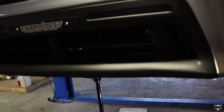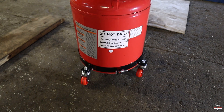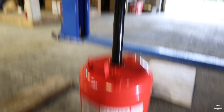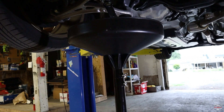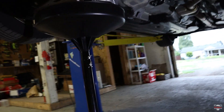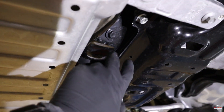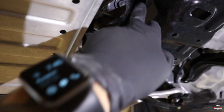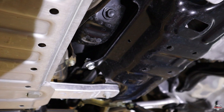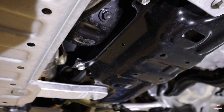If you're doing oil changes on a lift, I highly recommend investing in one of these drain catch units — pretty cheap at Harbor Freight, like 50 bucks. It keeps oil off your floor. Underneath here it's pretty easy to get to; Subaru was nice and put the drain plug in an accessible area. It's a 13 millimeter bolt, so grab a 13mm socket and ratchet and get that off.